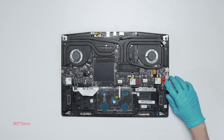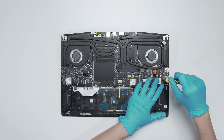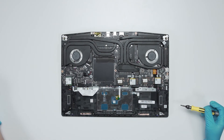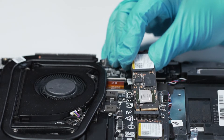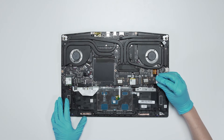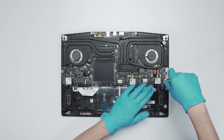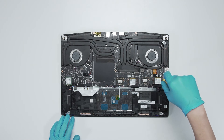If you want to upgrade the SSD, here is how you do it. Remove the screw on the SSD, then remove and unbolt the SSD. Plug in the new upgraded SSD, then screw it down at the end of the SSD so it is held firmly in its spot.